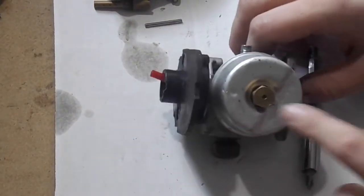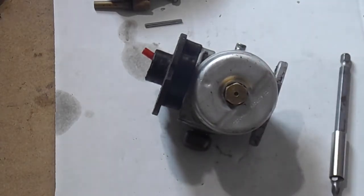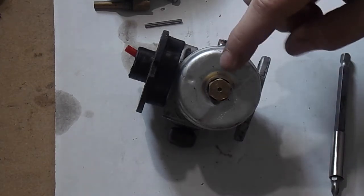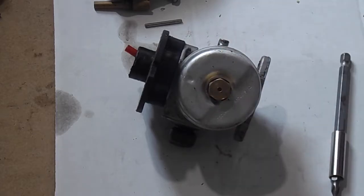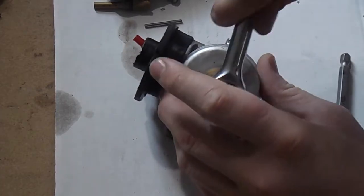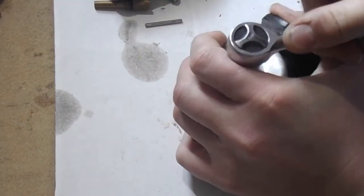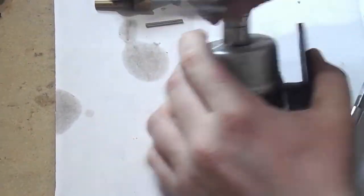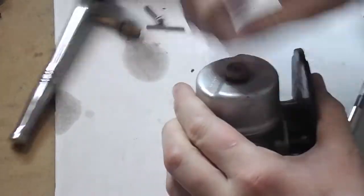This has all been stripped, so you've got different valves and ports going every which way. Now this style here — this is a jet right here. If this gets plugged up, the fuel inside the bowl can't get sucked into the jet and shot up to the top of the carburetor to go into the engine. If that doesn't work, you've got trouble. It's just a half-inch nut on the end. Sometimes these get plugged up too — I'll show you what a plugged jet looks like.